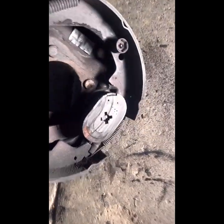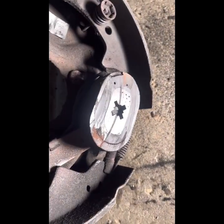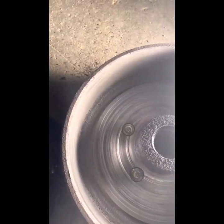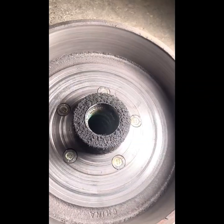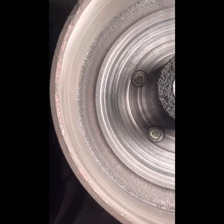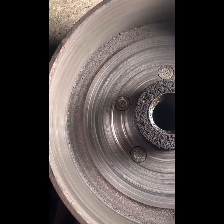You can see the magnet is in pretty bad shape, the hub's in bad shape — it literally just cut into the hub. To get that brake off, there's four bolts. They can be a pain; they might be rusted on there, you might have to use a little heat or some PB Blast or something. But once you get them off, it's pretty simple after that — putting them back on is simple. It's getting them off that's the hard part. Look how bad that rotor is — it's just completely cuffed in there.